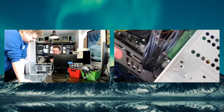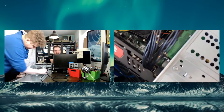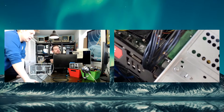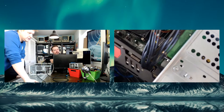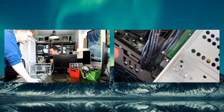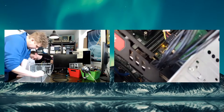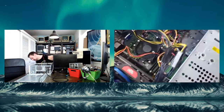Don't love that. Wait, what are you plugged into? You're plugged into the graphics card, right? Yeah. Okay. HDMI on the graphics card. Try plugging into the onboard. I mean, the graphics card is spinning, but... Oh, the light just went green, I think. Uh-oh. No. Yeah, we're not getting anything here. Okay. Plug it back into the graphics card, and then let's just reboot it. See if it needs to detect where the output is going first. Sure. Okay.